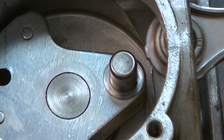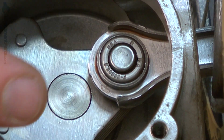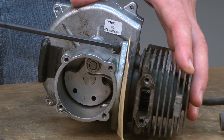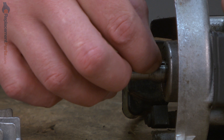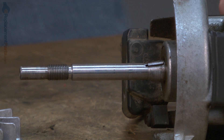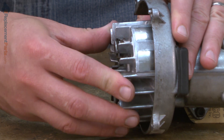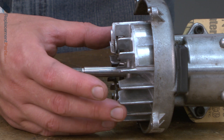Now I'll install the connecting rod onto the crankshaft. I'll slide the cylinder into the crankcase and secure the cylinder with the screws. Now I can install the flywheel. First, I'll place the Woodruff key into the slot on the crankshaft and give it a little tap to seat it in place. Now I can install the flywheel — I want to make sure that I line up the slot on the flywheel with the Woodruff key. The flywheel may stay a little loose at first; it'll get tightened up later when we install the clutch.